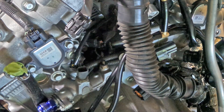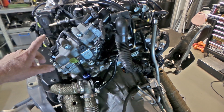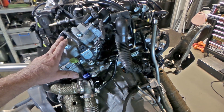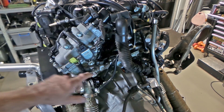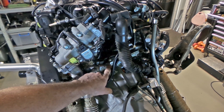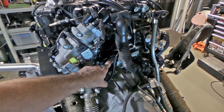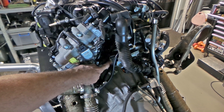I've also removed all the coolant lines to the throttle bodies — the heating lines to the throttle bodies which I'll never need. I live in a very moderate climate; it never freezes here. One of the points those lines ran back to is on this crossover pipe. I took it off the car, heated it up with the oxy, and that allows you to remove the spigot. With pliers, you can heat it up, start turning it, and take it out — it's almost the right size to drill and tap for 1/8th NPT. I just had to enlarge the hole slightly, tap it for 1/8th NPT, and put the temperature sensor in there.